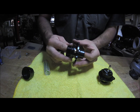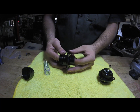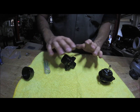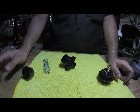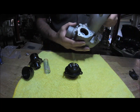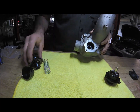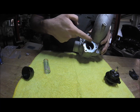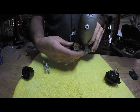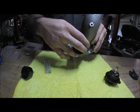First stage of operation releases back into the intake tract of the turbocharger. The second stage vents to atmosphere — however, in all states in Australia it is illegal to vent to atmosphere, so that configuration is not street legal. When fitting these valves, you can see there's a flat edge here — that flat edge represents where the vent port is on both the plumb back and the dual port. That flat edge must face the machined flat edge on the compressor housing, otherwise the vent port isn't facing the inlet tract. It will bolt on other ways, but that's not correct and it won't operate properly, so remember: flat edge to flat edge.